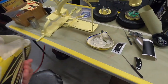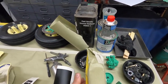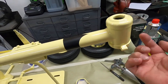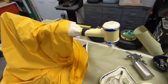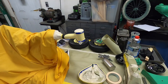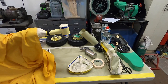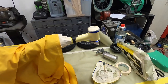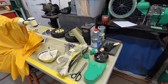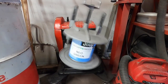The fender and the seat are taped, and that piece has the tape on it, so I've got to finish masking the frame. Then we're going to go out and do some spraying. That's what that's going to look like — all green up in here. I've got to tape these off and the rest of the frame. I think I'm ready to start mixing paint. I've got the fender, seat, wheel, and frame parts ready for green. Once I get those painted, I can start assembling stuff. It's supposed to rain the next couple days, so I'm kind of under the gun — if I wait another day or two I'm going to have to sand things to get it to stick.